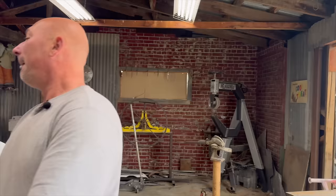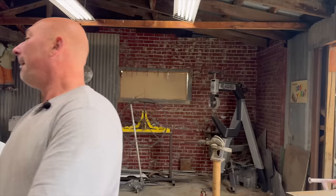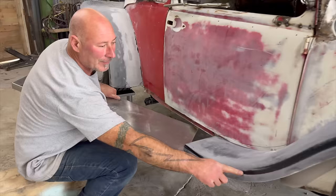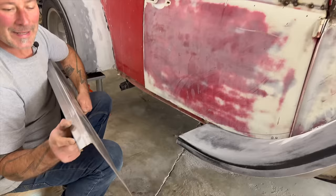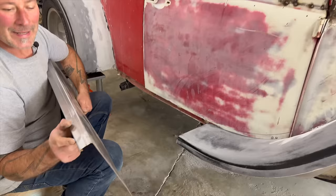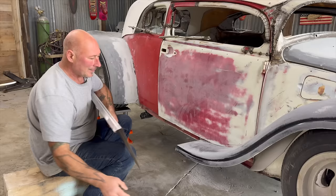I got this panel. See how it's got this detail here? I love this — I don't want to lose that to the entirety. This line is going to come through and turn up onto this rear fender. You can see how I made that out of steel. I'm getting that little bead. We got two different radius of bends. This one, you can see, is very tight. And this one's a little bit rounder. And then we have the detail of the body line. Let's get into how all that happens.